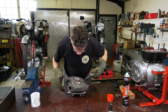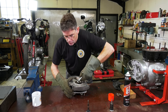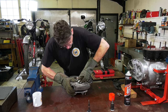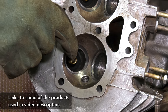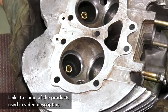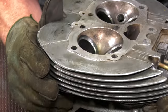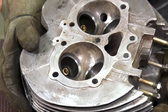These seats aren't too bad. It's quite an old engine, but considering the age of it, it's not bad. Just a little bit more on these exhaust ones. The seat itself is now quite clean — you have a nice taper. So that now is really ready for a valve to be lapped in, then we put the springs back in and that job will be done.